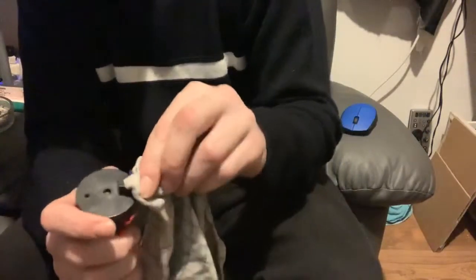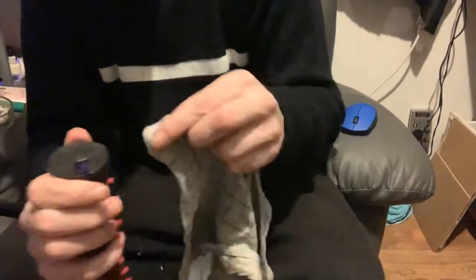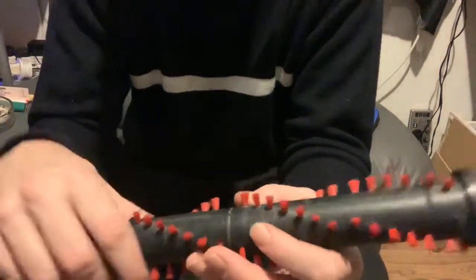If you switch your cleaner on and it sounds noisy, that's another reason to be changing them. But if you're going to change them, go to the effort of cleaning the brush bar back up again, getting all the dirt out of the end caps, any hair that's in the end caps out, and make it nice again, and the machine will look after you.